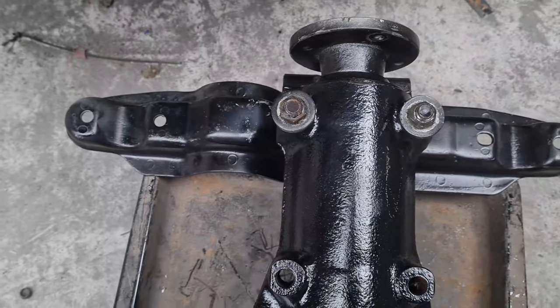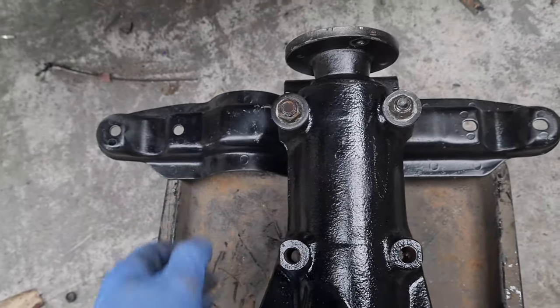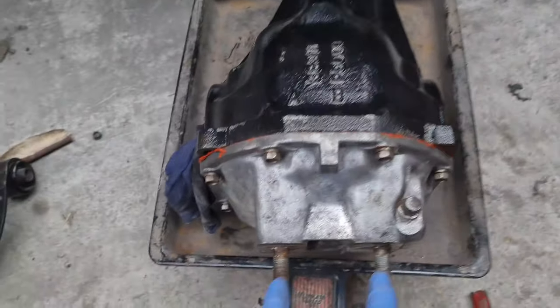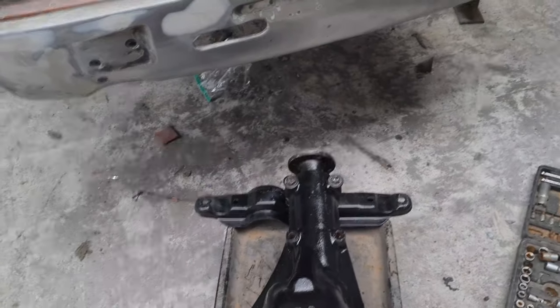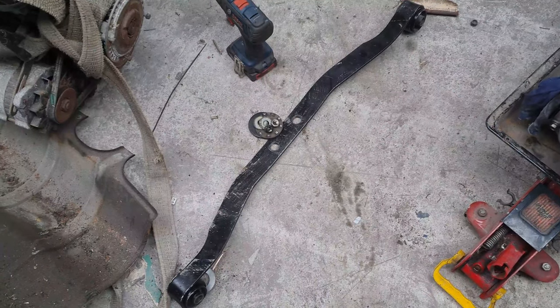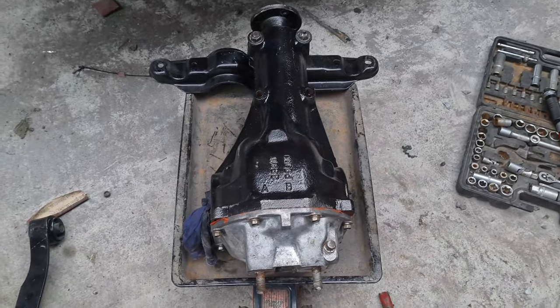I think I've got it assembled correctly this time — two bolts torqued down at the front, the damper torqued underneath, and this cross member attached. These two bolt holes are spread further, so we're going to move it in and lift it into position. Then just see how close our moustache bar is and what kind of modifications are needed there. So let's move her in.